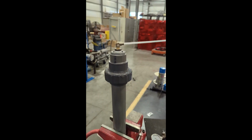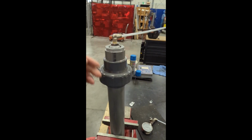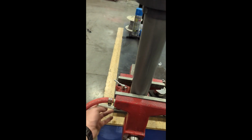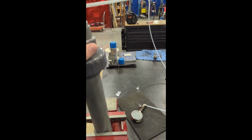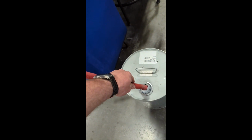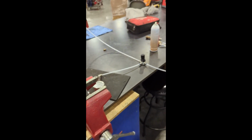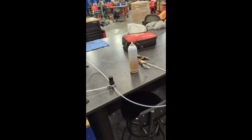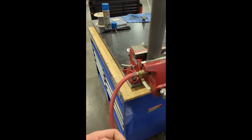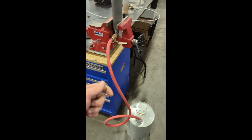That's the vessel. It's a union. Unscrews. Throw my carb cleaner in there. Close my valve while I'm doing it down here, and then I'll screw it back on. I'll take my fuel injector, plug him in that end, tighten him down with a line clamp, and then I'll end up hooking up the air hose, priming the pressure, and then I'll go back and I'll actuate the fuel injector with my little Milwaukee battery, and the switch